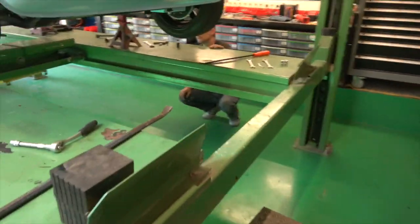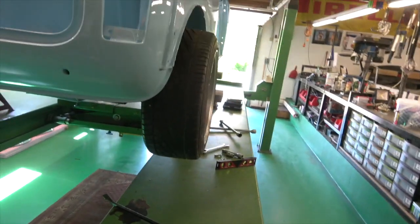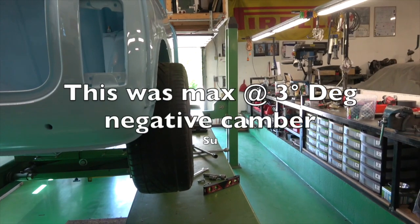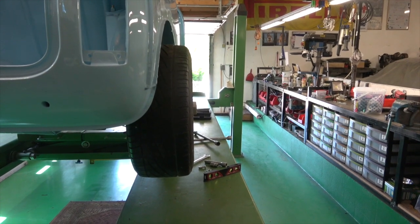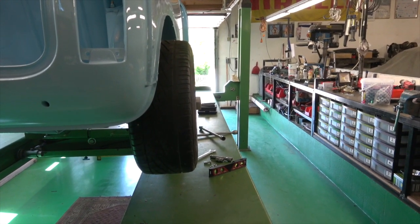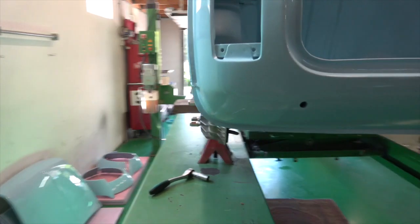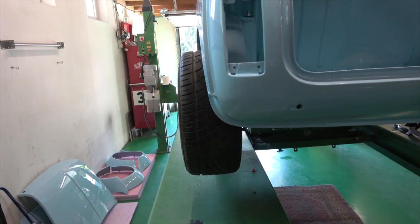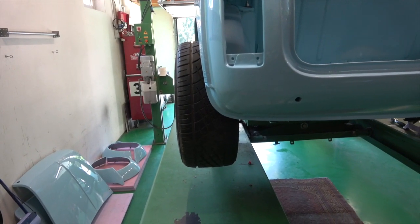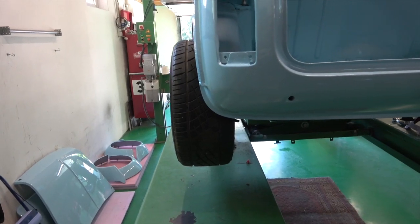You can't see much on the hub itself, but when you look at this wheel — we've just put two bolts on it — you can actually see the camber on that wheel. If I keep it straight, you can see from the outside tread how much camber is on it. That's going as far as we can go with it — we'll obviously have to play around a little bit, but it's a very basic kit and we'll see how well it works. These are now sitting at one and a half degrees of camber.